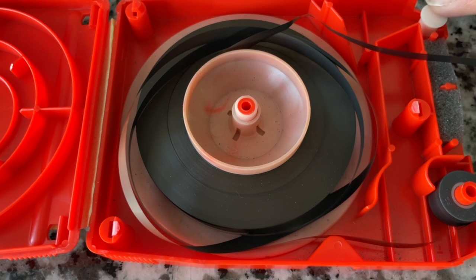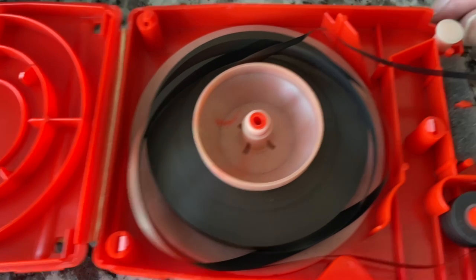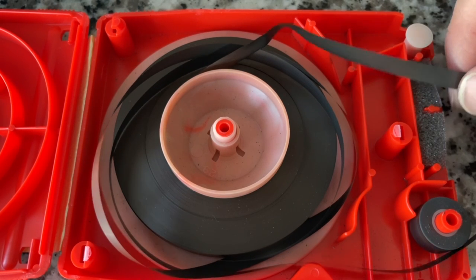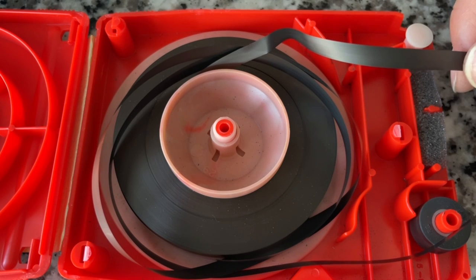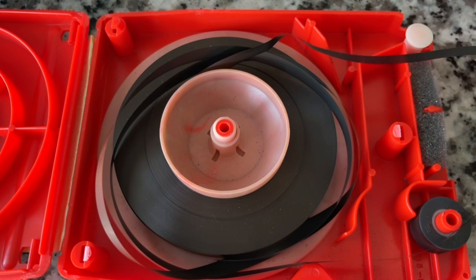From a physics standpoint, something that's happening during this process, as the tape is playing and progressing itself to the center of the hub and coming back off of it, is the tape is sliding on itself. So 8-track tape uses a special substance on the back of the tape that gives it a little bit of lubrication on itself. And I don't know if it's a type of mylar or some kind of thing they add to it, but that's the way that is.